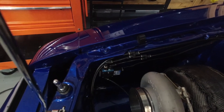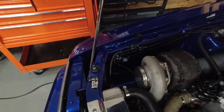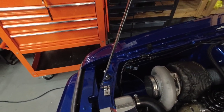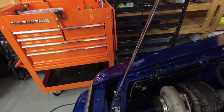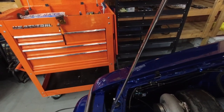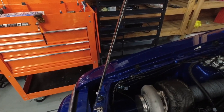With an aftermarket computer like that, people use several different approaches: a three-port MAC valve, a four-port MAC valve, or a dual three-port setup where you have a plus-boost and a minus-boost valve. This car had a three-port valve on it. Basically what it does is divert boost from the source and put it onto the top of the dome of the wastegate, which helps hold the wastegate closed. That is limited in the amount of boost you can make because your source is boost from the turbo — you can only put so much pressure on the dome.